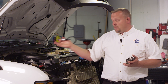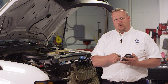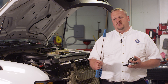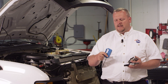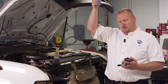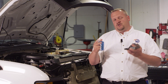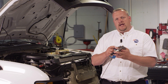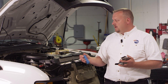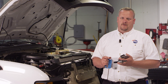We're going to replace the actuator as well while we're already in there with the valve cover off - good idea to replace the control actuator. One of the key tools to doing this job is this wedge tool. It's got some nice hand grips built in. We're going to pop the valve cover off and wedge this down inside the engine to prevent the chain tensioner from collapsing while we've got the chain and cam off. We've got three great parts to install.